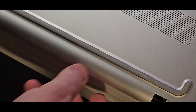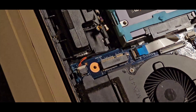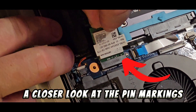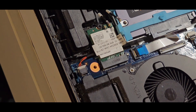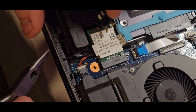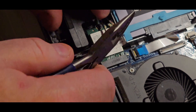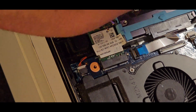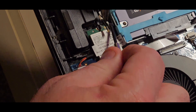I put the back on the old laptop — James's laptop, that's my son — so it didn't damage any components; we used it as a makeshift table. We push the new card in — it just goes in one way — and then screw it down. It gets a little bit fiddly, that's why I like to use tools. Using a pair of pliers we can attach the antennas. They can be a little hard to clip in; they have a tiny little pin that goes into the middle of the wire itself. What I like to do is come at it from the front with something like a screwdriver and gently push it down, and you'll feel and hear a tiny little click.